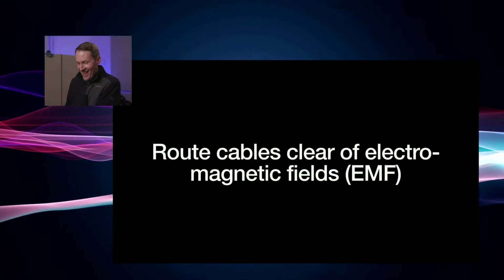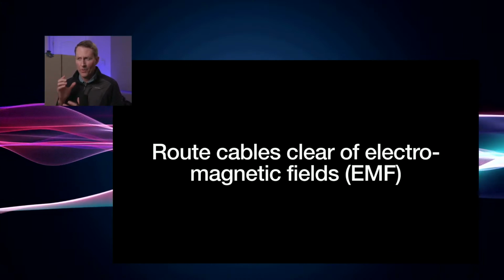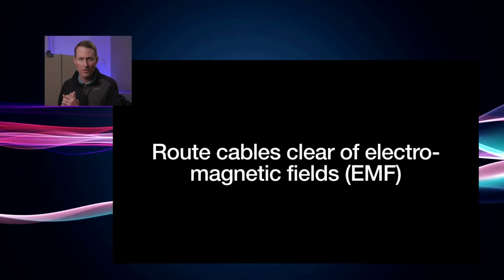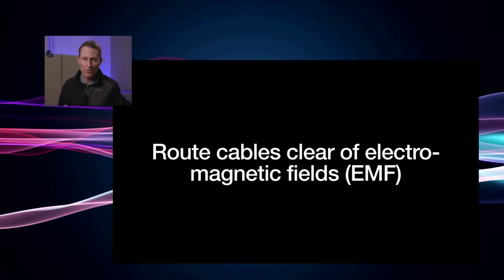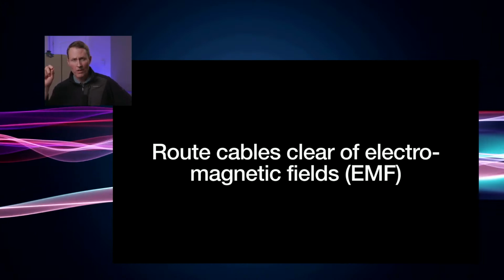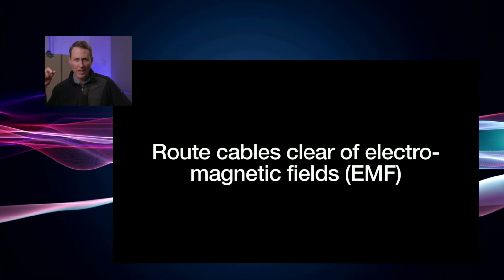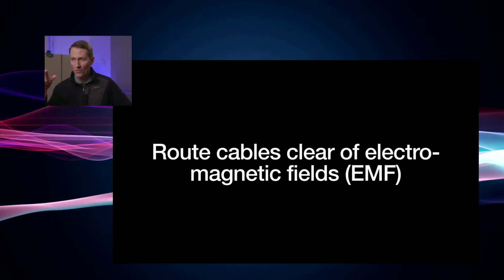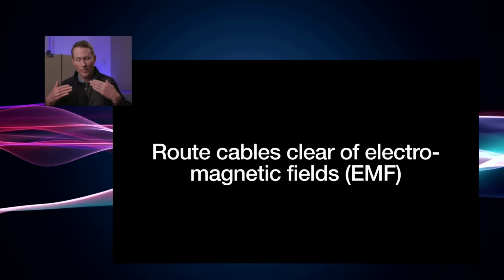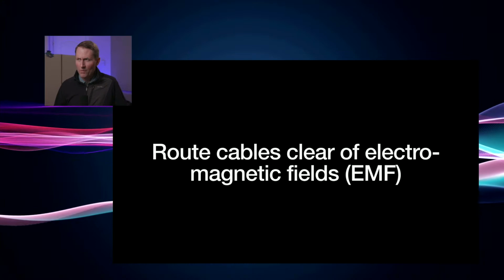Okay, I think you get the idea there. It looked to me in that particular sample that the MacBook's power adapter was probably the noisiest. Obviously, when you sandwich a cable between AC adapters, that's going to be probably the worst possible situation. The reason I bring this up is that this is actually very much a real-world issue that you need to consider. The Monoprice cable will pick up plenty of that. Other cables can as well. So even with higher quality cables, you still want to be careful about routing them between AC adapters or near AC adapters or anything, again, where there's especially a lot of current flowing through an electrical run of some sort. So just one thing to keep in mind there.